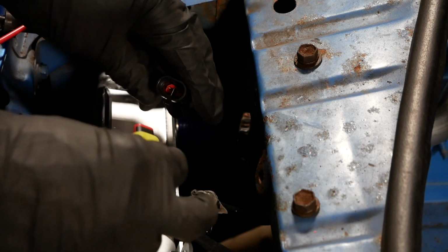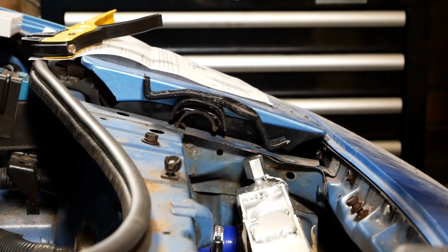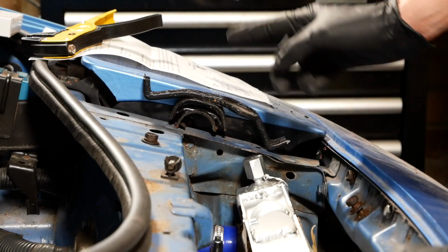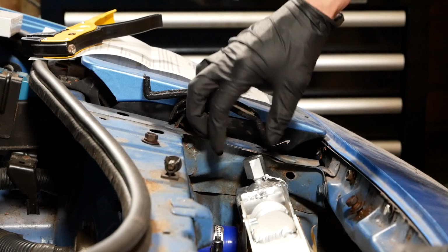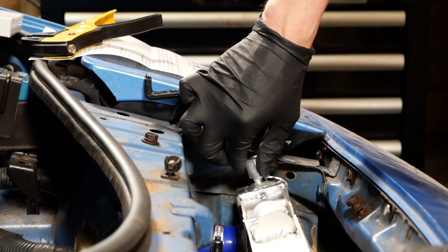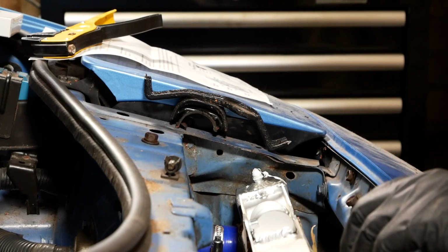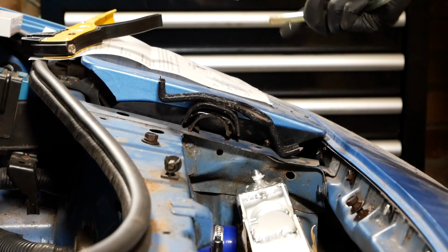we have a fan. Now I've got the new radiator in, you can finally get back to what started this whole mess, when I was trying to set the radiator up for bleeding the cooling system and discovered I couldn't remove the bleeder valve and then found the radiator was shot anyway. So one of the reasons I like this Mishimoto one is the bleed valve is on top, so let's remove that. Clear off this PTFE, get this length of hose.